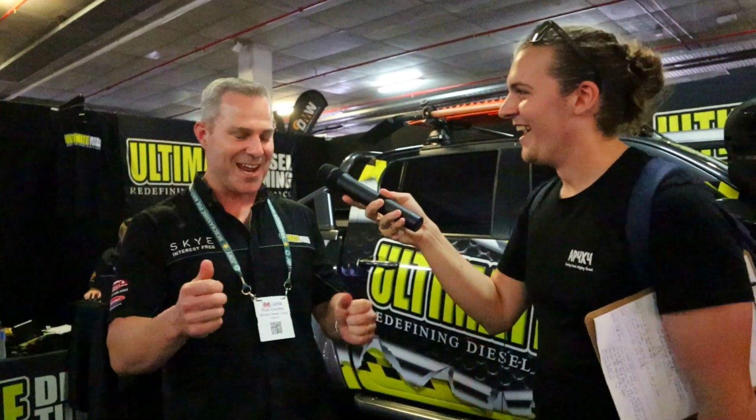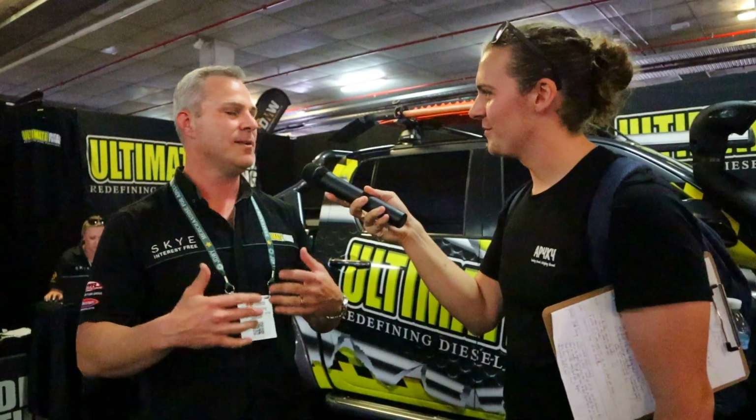And by diagnosing it on the dyno on an effective running road, you can see those issues. It's not going down the road at 80 k's an hour, looking down and trying to do something, where we can hold a car at 3,000 RPM and see what the vehicle's doing, or 2,000, and see what the vehicle does at 80 kilometres an hour, as an example.